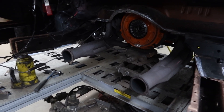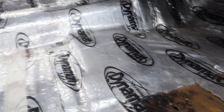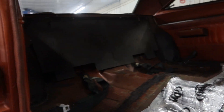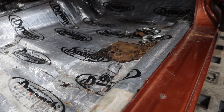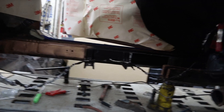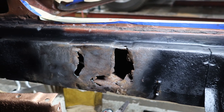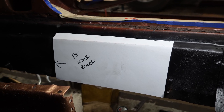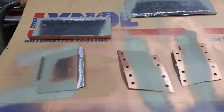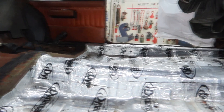The boys have done real well. Kevin and Jerry worked real hard to get this floor out. Unfortunately, the DynaMat hiding the rust made this job a lot more difficult than it needed to be. It's really unfortunate that this rusty floor was hidden by DynaMat and undercoating. We've also identified quite a few areas that needed to be patched prior to putting the new floor back in. Jerry's currently working on making patches for everything, and once we get the patches done and treated, we'll start putting the floor back in. The DynaMat made this project a lot more difficult than it needed to be.